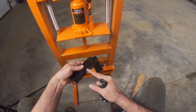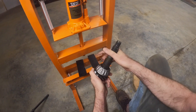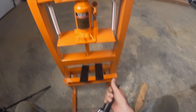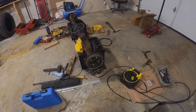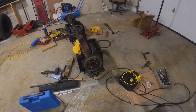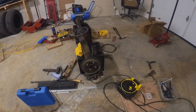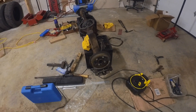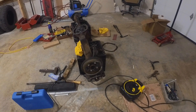I can see now where that noise was — looks like it took a piece right out of that. Anyway, it's still a good bearing, still in good shape. It's a little more investment than I wanted to put in the car. If these gears don't lower the ET as much as I want, I may want to drop back down to either stock or maybe 3.73s — I think the 3.90s on the highway might be a little bit of a pain. So at least now I have the tools, and by the time I get this done I should have the know-how to switch gears fairly easily. Anyway guys, thanks for watching and we'll catch you in the next one.